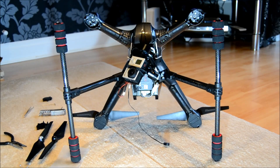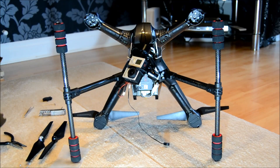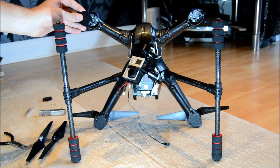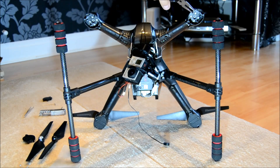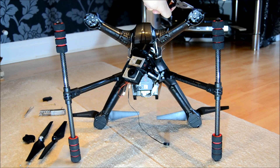Moving on to the second problem I've got at the moment. Having taken the plastic covers off each side here with a Phillips head screwdriver — just two screws to pop off these dust covers — we have an issue with these clips which lock the casing and stop the motor and the shaft here from moving up at the top. What we have is this side here is missing one compared to the other side, so we're missing a C-clip on this side.